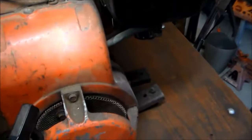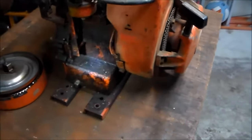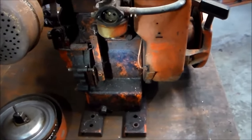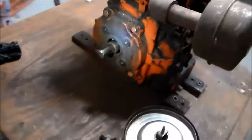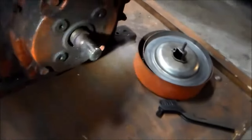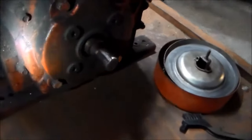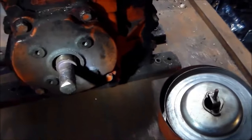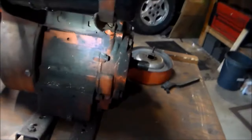This is a 64 or 74, and I don't see a point set, so that's electronic ignition — cast iron block. I was expecting a Kohler so this is a surprise. The throttle control here looks constant, not adjustable — you can't idle it down, so I need an assembly for that. Unfortunately the crankshaft is pretty hacked up: there's no keyway and it's not tapered either. I might have to source a new crank if I want to use it for a snowblower or garden tractor horizontal shaft application.